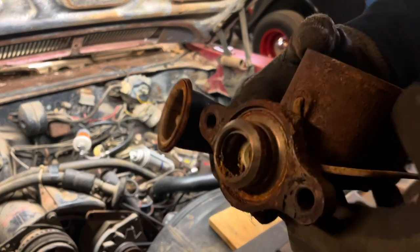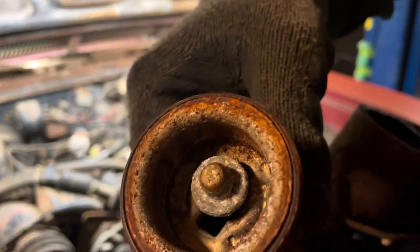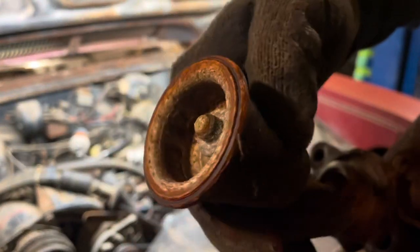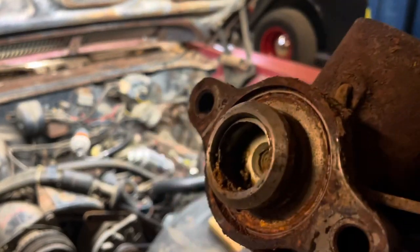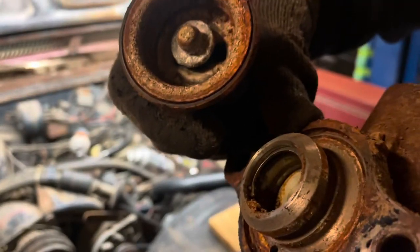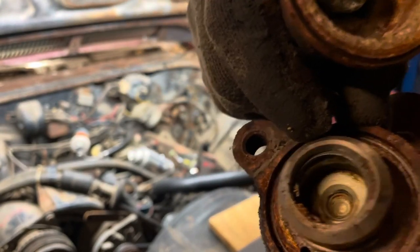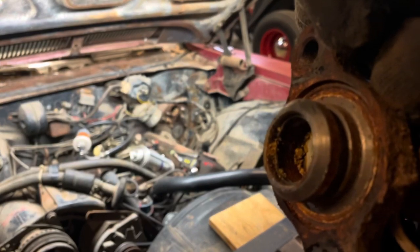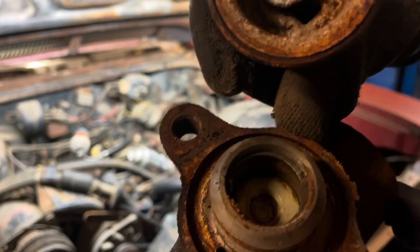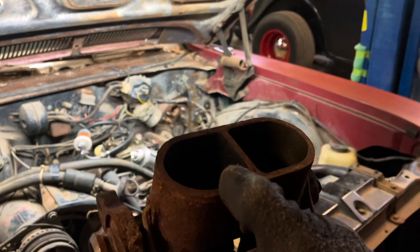Just wanted to show you, I got this popped off. It's got a little metal thing in there. It's pretty cruddy. Probably just gonna run it through the sandblaster real quick, put some flat black paint or something on there. And then the pin, you see this pin here is actually seized. The plunger is seized up in there. It should be all the way out here to the face. And it's locked up in there, probably 3/4 of an inch deep. So it's been leaking, you can see that sediment. These just are not worth fooling with, in my opinion. Like, these are $30. Just go buy one.